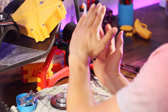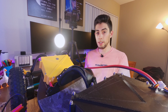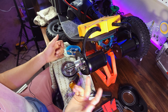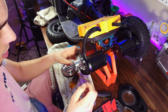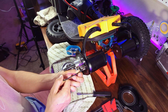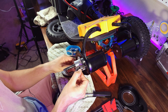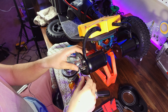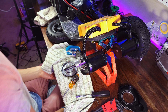Now is a good time to check what angle you want to set. Then attach your motor with four M4x8 screws — the same screws that attach the plate to the adapter. It's really important to leave your motor screws a little bit loose right now, because you'll need to adjust where the motor sits so the gears properly mesh together. It's also a good idea to apply some blue loctite to the screws when you attach them for the last time.